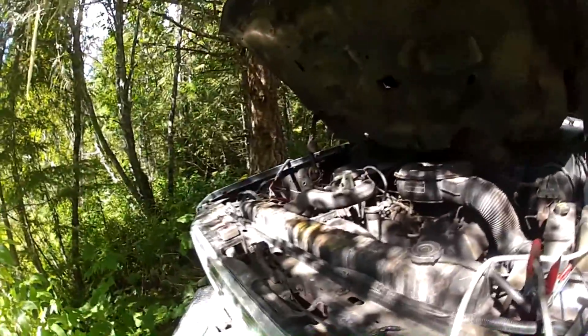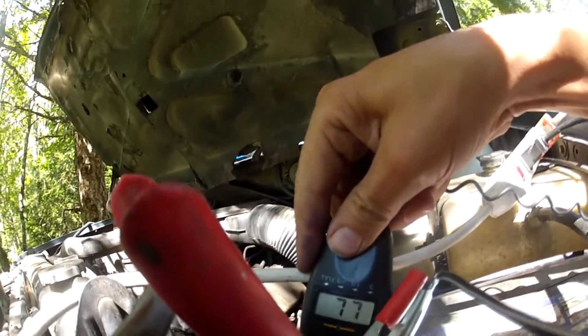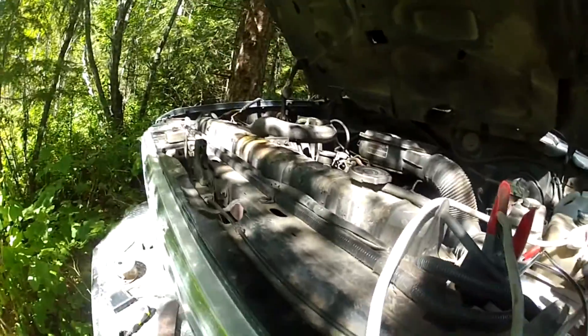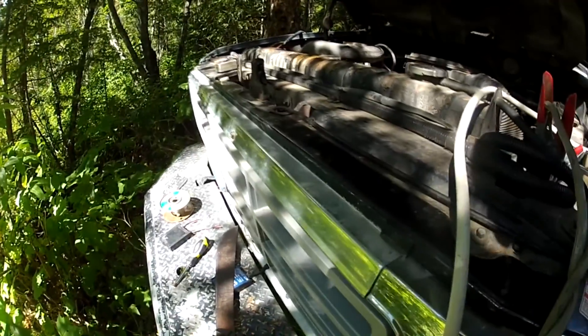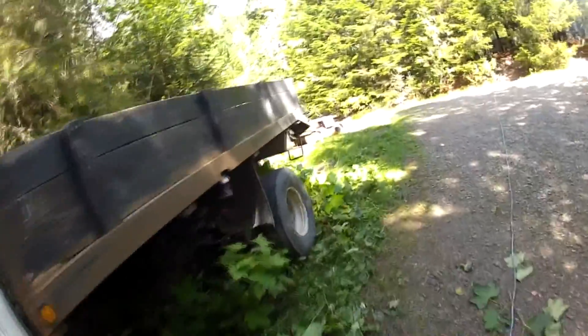Up at the truck, the pump runs off the system. The pump draws up to 68 amps — a lot of times I'm in that range. Right now it's charging at 11.9 volts, holding its own on a 2-amp charge on the battery, with 10-gauge battery cable wire.